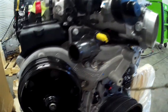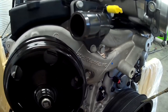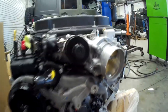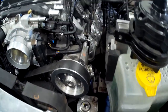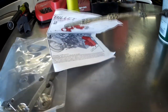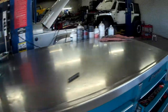We are running an eight-groove belt for the supercharger — you don't want that to flip. The balancer actually has three sets of grooves: one's going to run the air conditioning, one's going to run the water pump and alternator, and one's going to run the blower. We are going to fit a Type 2 GM power steering pump right here. In this build we installed a PSC full hydro assist. Here's another option — a billet mount from ICT that's going to mount a Type 2 GM power steering pump to the LT4.